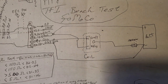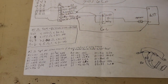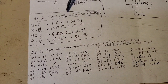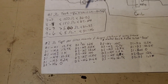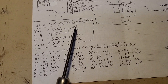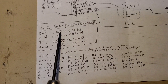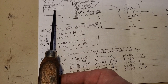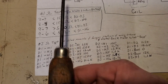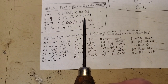Follow your color code and your wiring on your spare connector. There's also another YouTuber called Cars Trucks and Detours who has provided a resistance-check type test, which tells us that if you go from D2 to D3 you should have 150 ohms. So D2 to D3 is 150. D2 to H4 — he's saying you get a certain resistance reading.